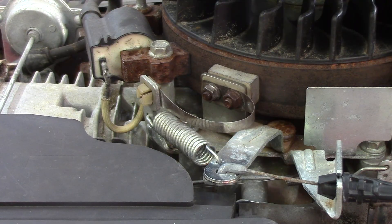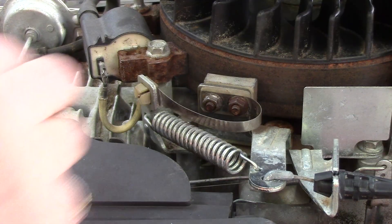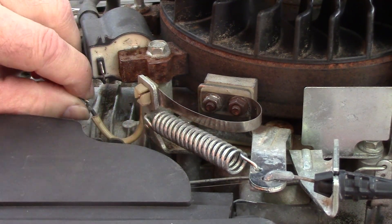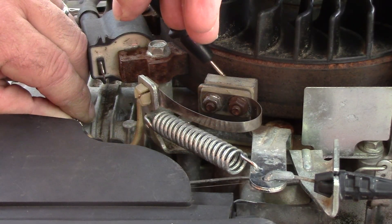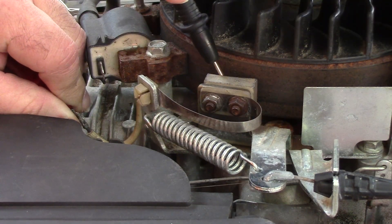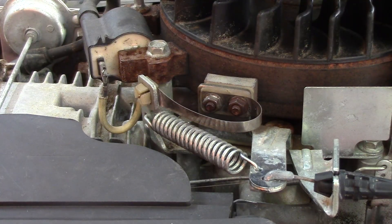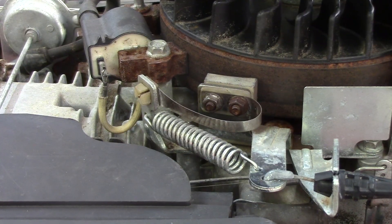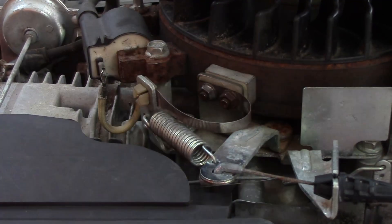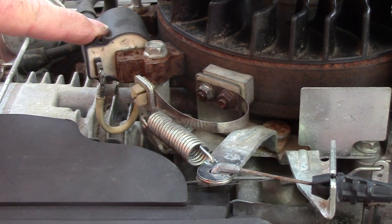The question I have is — are we getting continuity? Let's squeeze the bail again and just test. Pull the wire off there, use our continuity tester. Do we have continuity from the pad — the brake pad — to the kill wire? And we do. You can hear it beeping. So this should be killing our engine when the brake pad grounds itself against the flywheel. But for whatever reason, that's not happening. We're not getting continuity that's strong enough to actually stop the coil from generating spark.